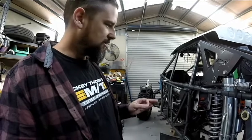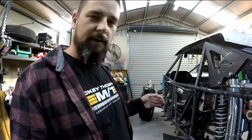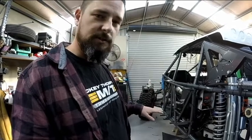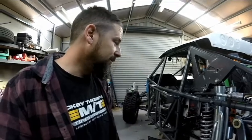So for that reason, what they recommend is you get your smart wire, you wire it up with just your power and your grounds, you program it, then you wire it completely out to all your devices that it's controlling, and hopefully you can go through and commission all your devices that you've wired in, and hopefully you get it right. By doing it that way, also you'll get a better understanding of the capabilities of the smart wire.